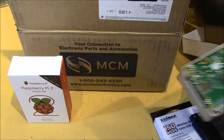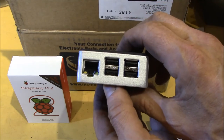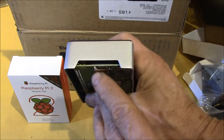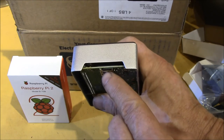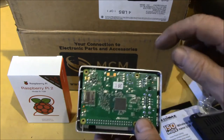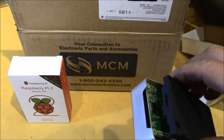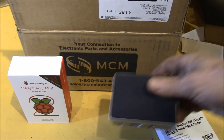I have enough parts to build. I think I'll build this one up and hook it back up to my Sony TV. You have to load a new OpenELEC or RASPBMC image that's built for the quad-core processor — you can't use the same SD card. And then you also have to get a new set of MPEG licenses. So I'll show you how this Raspberry Pi 2 boots up once I get to that point.